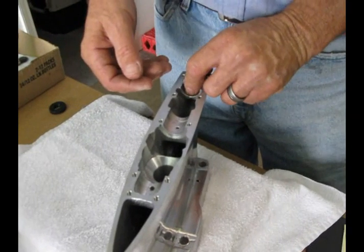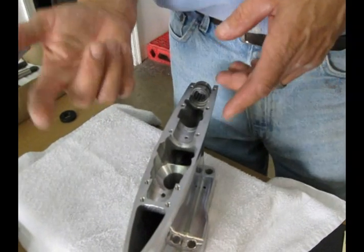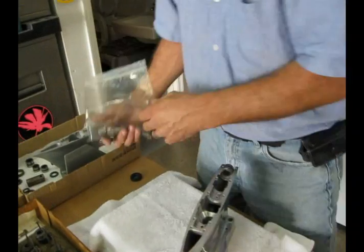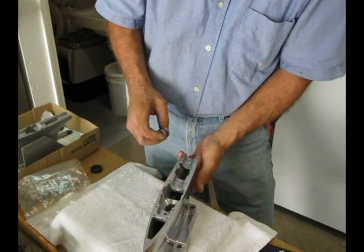The engineer said that what you have to have is a way for the oil to get in and a way for the oil to get out. We're turning a shaft at 13,000 RPM, so we have centrifugal force more than anything. If I've got oil walking up the shaft, I have to give it a place to go. So all of these bearings were replaced and we put this type of bearing in. Some folks already use that — great.